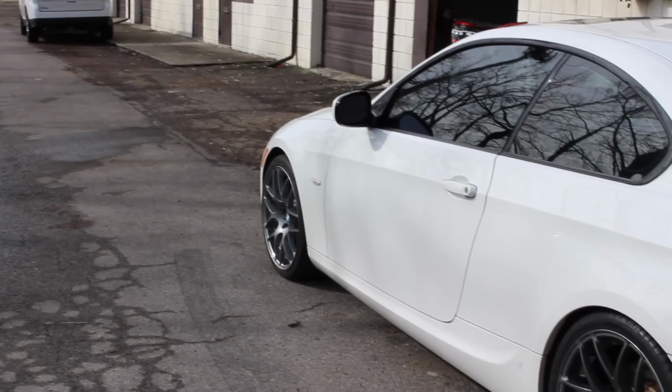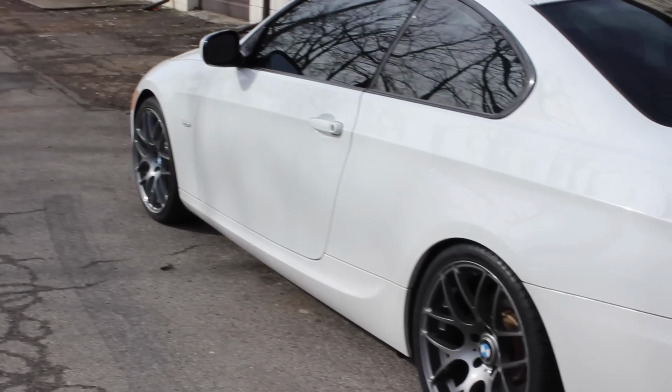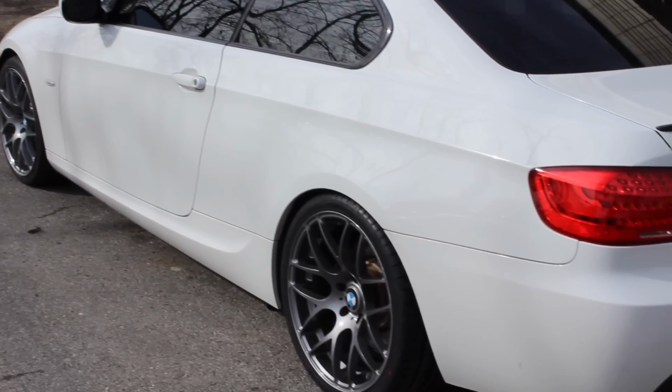And as far as how wide, these wheels are 8.5 and then 9.5 in the back. And before, I think I had 8 and 9, I believe the 193s were. So I went a little wider, and then the offset was very similar. I think now it's in the mid 30s, like 33, 34, 36, which is much higher than I had expected, but it's not that different. And you also want to consider the offset, and that's going to be that number that says ET whatever. So mine is ET33 for the front, I think. So if someone asks, that's your offset.